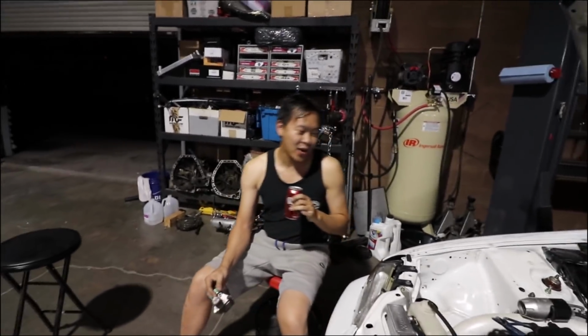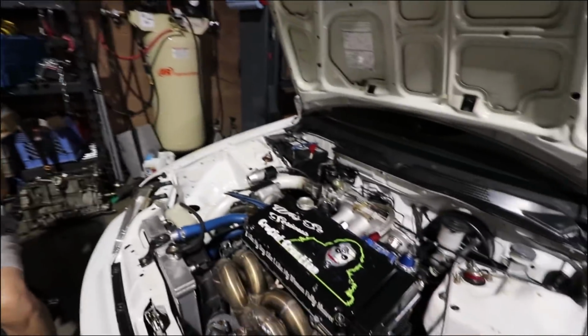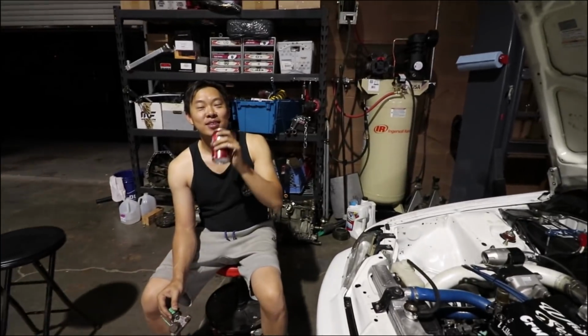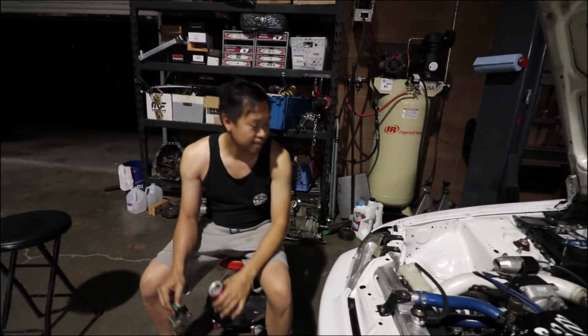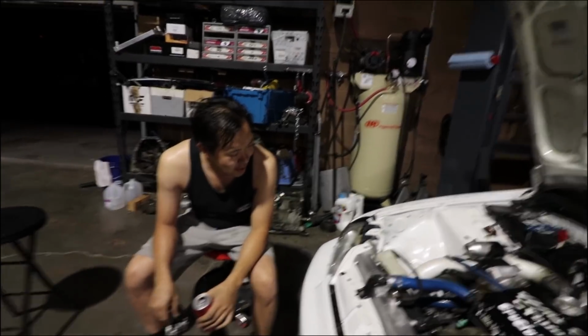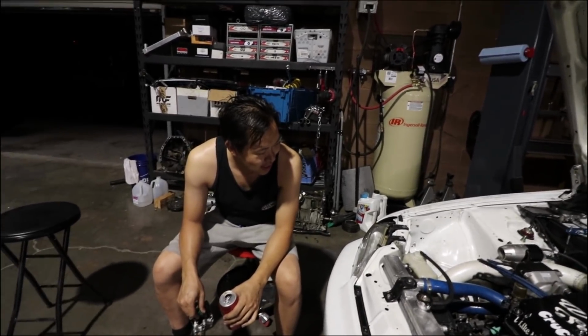It only makes a sound. Yeah, no, that's a myth, 100%. VTEC engages through oil pressure to lock-in pins. As long as that thing opens, the lock-in pins engage. It doesn't matter what size the valve is. So man, it's just hilarious.